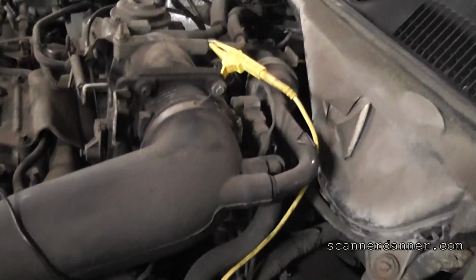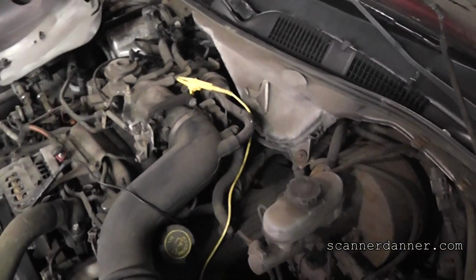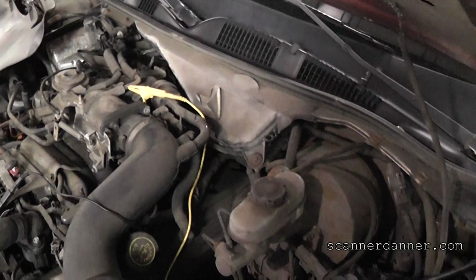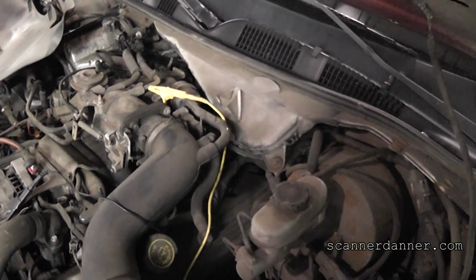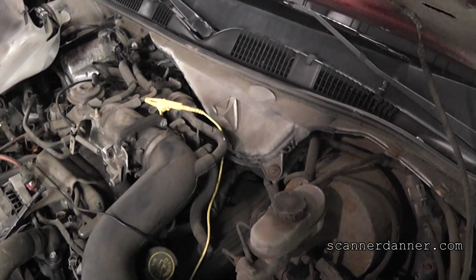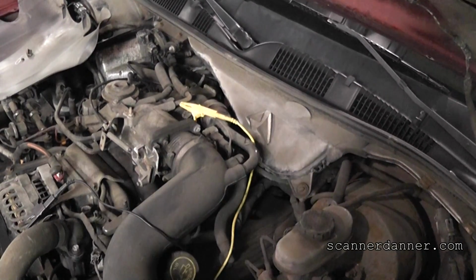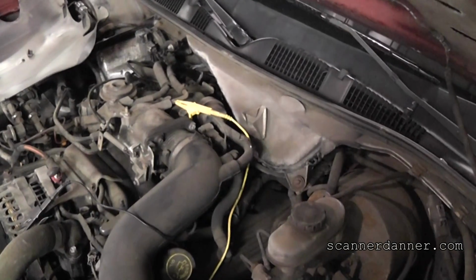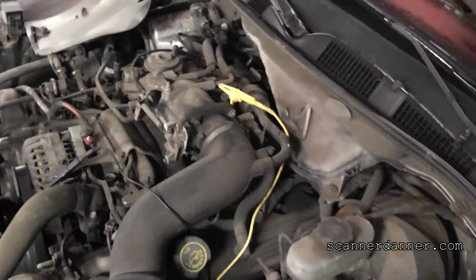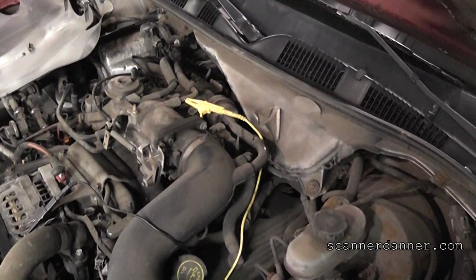So there you go. And again, I know that some of you are like, why didn't you just do that in the first place? I'm just telling you from the standpoint of they don't all unstick themselves. Our problem with this car was a stuck, closed idle air control valve. It is a common issue on these Ford solenoid type valves. And that's the field test, is to smack on it. And if the car idles now, you're good. Change the valve. Some of you guys might say, why don't you clean it? I haven't had success cleaning this kind of valve. Some of you may have.